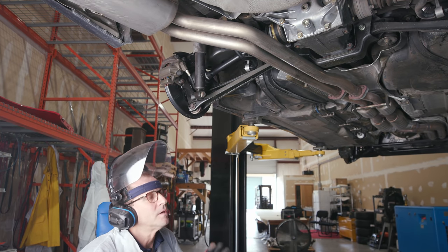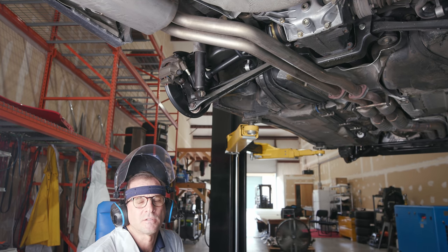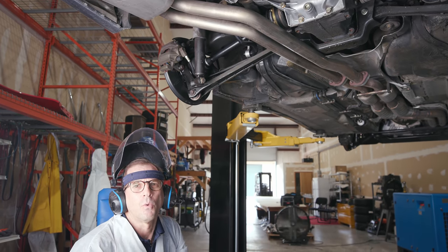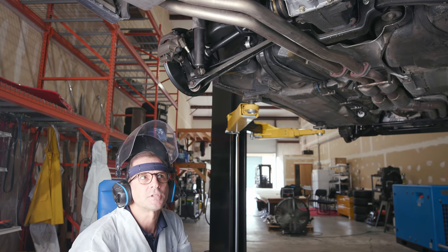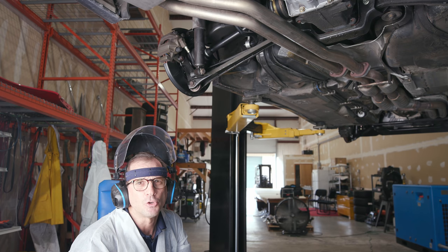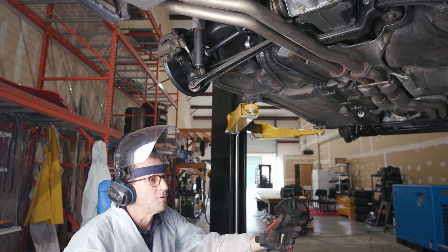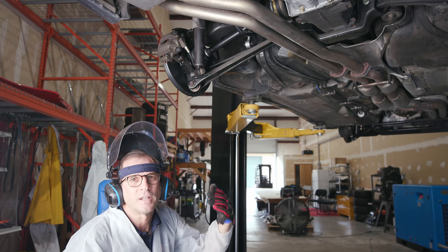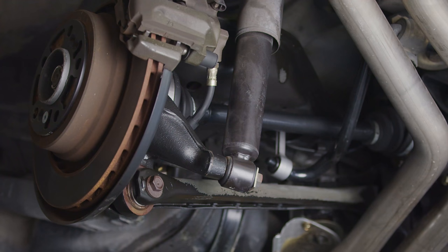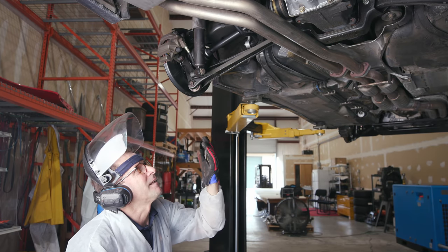So if you missed it, why is this a dry process? Because when dry ice sublimates, it doesn't create water. Why do we have moisture on our surfaces? Well, it's because it's about 80% relative humidity today, and it's 82 degrees. So it's just like a glass of iced tea. If you're in Arizona and the humidity's 15%, there's no condensation in the ambient air, so the glass doesn't condensate. We got humidity and we got high temperatures, so that's a reality that we have to deal with.